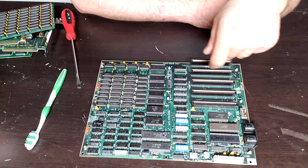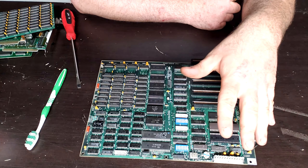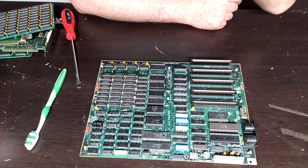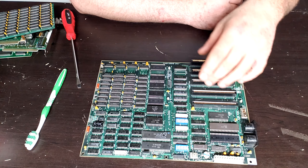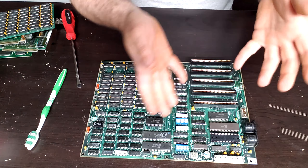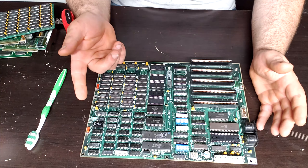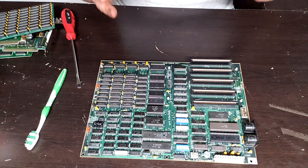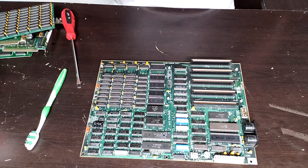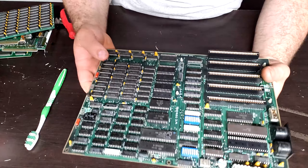This means this thing can take the full 640K of RAM, because I believe the very first revision could only go up to 384K or 512K depending on the RAM expansion card. This had a hard drive controller in it — and that particular WD card apparently had compatibility problems with some early Revision 1s. There was a forum post that mentioned this. A lot of the date codes are indicative of this being a very late revision board.